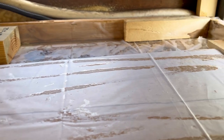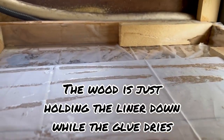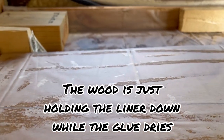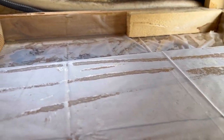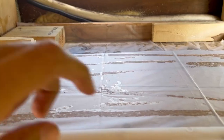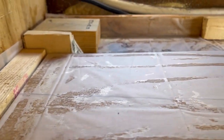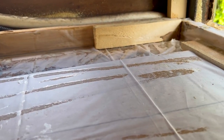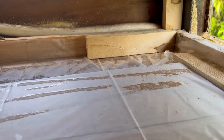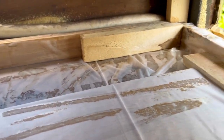I've added this liner in here — this is actually just a shower curtain. I looked at the shower pan liner and not only was it way too thick, but it was way too expensive. What I've done is put this board in the middle here that the unit will sit on, and there's going to be a moat around the unit to help drain the water off, because I couldn't really angle this, and the bus being on an angle anyway, the water is kind of just going to sit until we move the bus if it isn't angled properly.